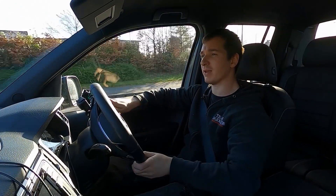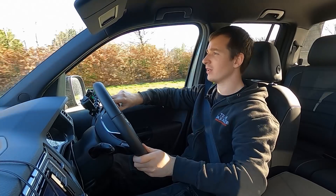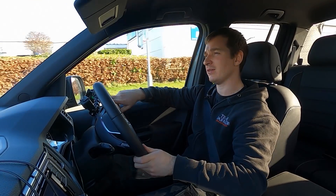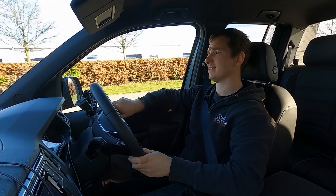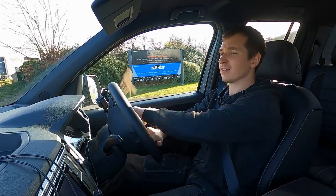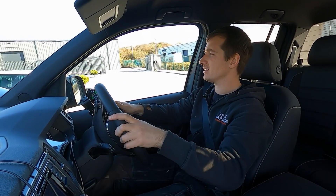I don't think we're going to bother making a gearbox oil cooler for these unless another business case comes up. We are going to upgrade the intercooler and the oil cooling system, but it seems to want to run at 110°C all the time - there might be a thermostat in there that only opens at 110°C for the cooling side. We might have to look deeper into that. There's definitely a decent market for parts for these so we don't want to miss anything.